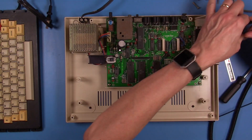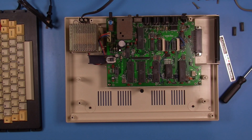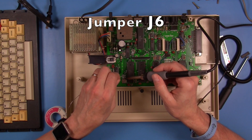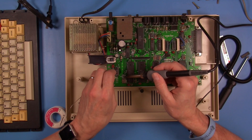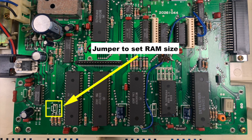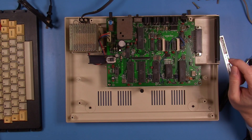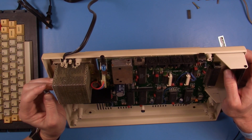The other thing that needs to be done to upgrade this system from 16K RAM to 64K RAM, besides just installing the chips, is there's a jumper on the board identified as J6 that you have to bridge in order to allow the system to see all 64K. This is specifically for the 20261044 revision of the system board — other boards may have a different configuration or the jumpers identified differently when you upgrade to 64K.